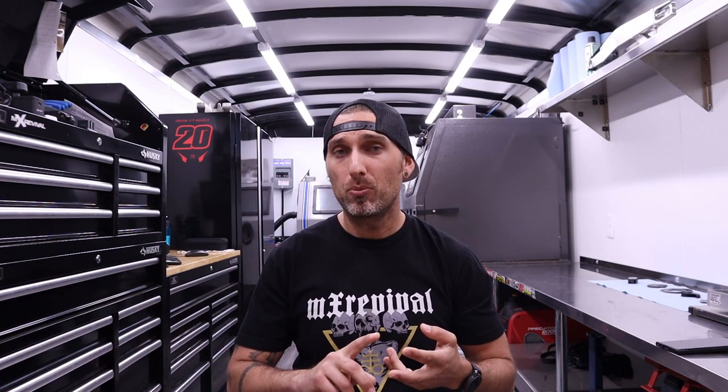So here's the big question, right? Do you keep your stock carburetor, or do you need to run out and replace the Lectron you're currently using with the new Billetron from Lectron? Well, it depends. Obviously, all of them work just fine. Some a little better than others, and every situation is different. But for me, I will be rocking this Billetron in all of my two strokes from now on. It has the bottom end grunt of a perfectly jetted Keihin, except it doesn't have jets like a Keihin, and the new Billetron is also not going to be sensitive to elevation changes or temperature swings like the stock Keihin, even if it's well jetted.